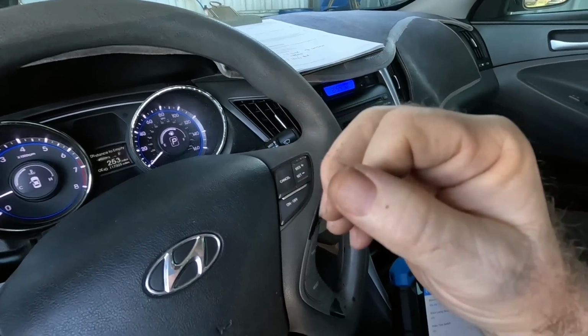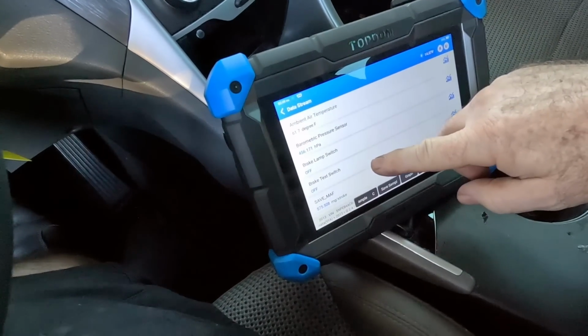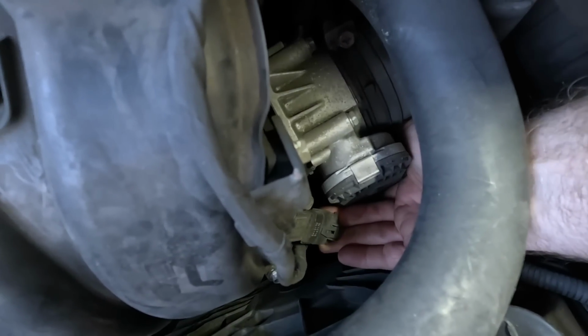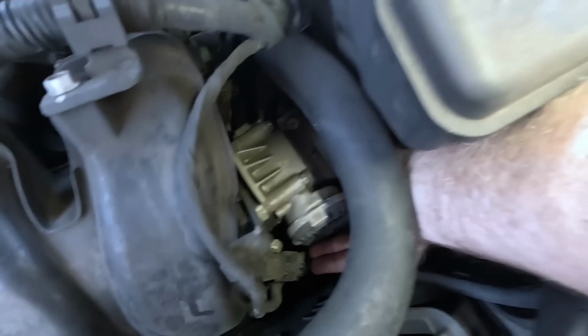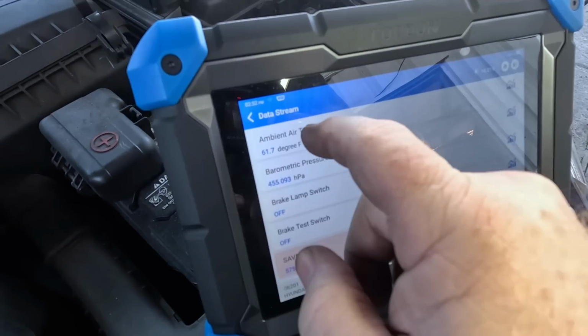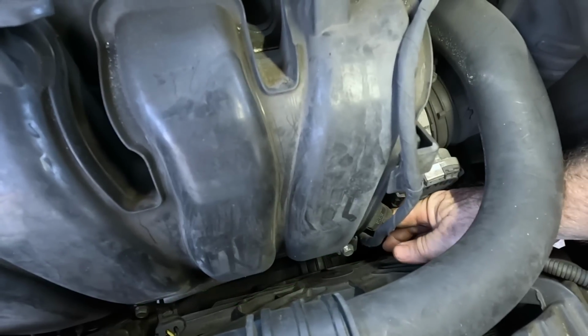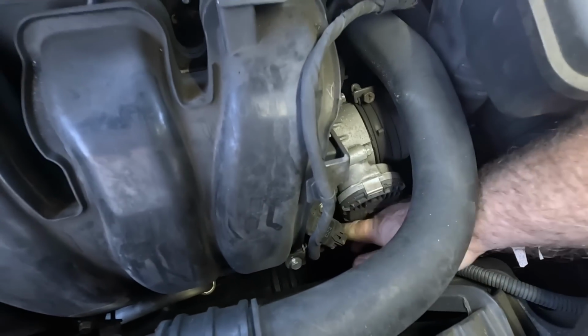That's unusual. I'm going to look around under the hood at this mass airflow and map sensor issue, see if we can find something weird where they're maybe jiggling a connector, see if something changes on the baro or ambient air temperature. There's my map sensor, giving it a little jiggle, and nothing looks to be changing. I'm really concerned about the temperature one, because that's not accurate.